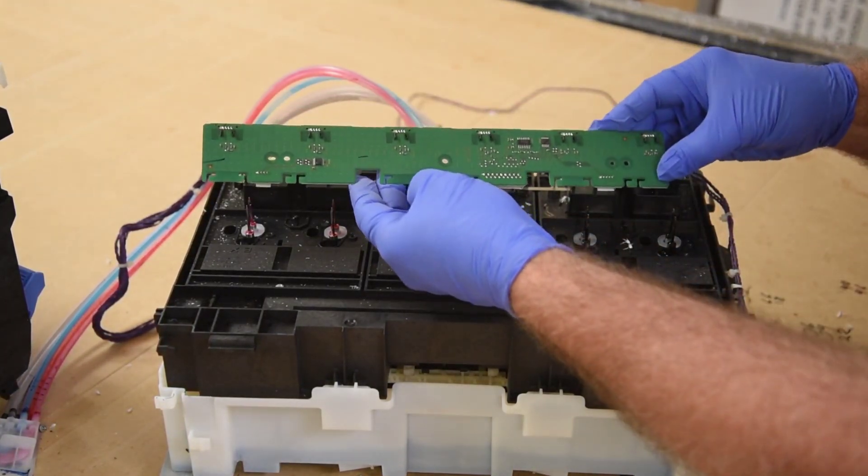Let me clean it up a bit and try to get as much of the ink off as possible. I'll put some isopropyl alcohol in the diaphragm area and see if I can find a leak. I don't see any obvious cracks in the diaphragm. I'll wiggle it around a bit - not getting any of it seeping through. The rubber diaphragms are all one piece of rubber and look to be in good shape. I'm going to take apart the matte black pump just to see if I notice anything different between the two. I do notice one thing right away: the pump that was leaking had ink all around the rubber insert, and the one that isn't leaking is nice and clean all around the rubber insert. And here the seating area on the tank has ink on it, but the tank seating area for the non-leaking pump is nice, dry, and free of ink. Could it be that the pump plate was just not tight enough and the ink was leaking around it?